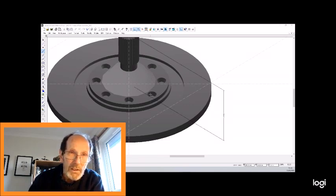The first motion shaft pinion, these holes in it have to be welded closed, and not just covered, but properly welded. The circumference of the first motion shaft drive pinion, the diameter of it needs to be increased by 2 millimeters because the holes for the 2CV clutch friction plate will be too near the circumference for comfort.